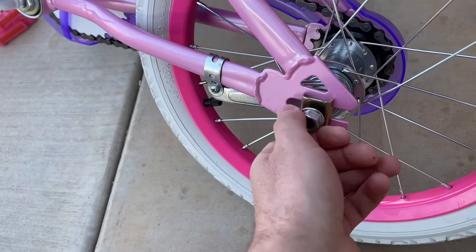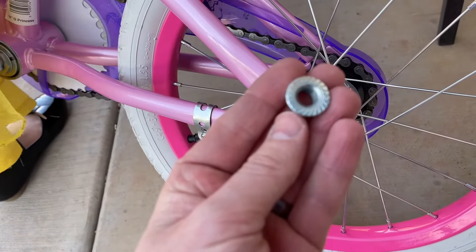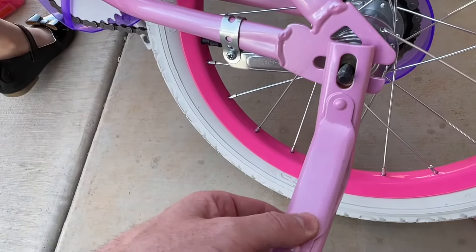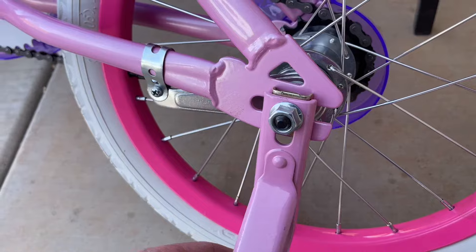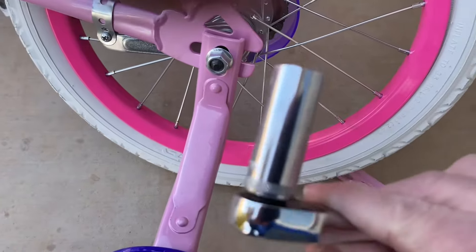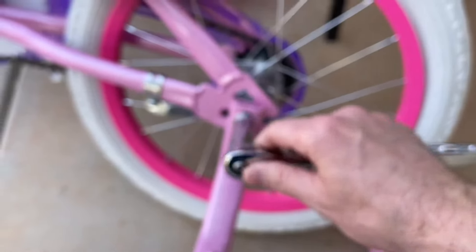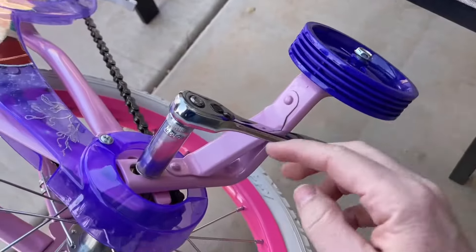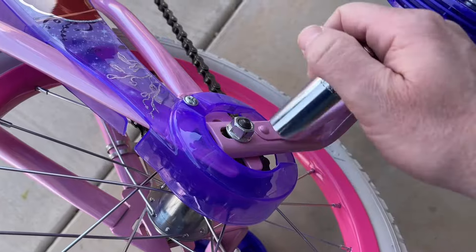As for the training wheels, this hardware was loose assuming you're going to put the training wheels on. Take the nut off and check that it has those good perforated lines to confirm it's the right hardware. The training wheel just goes right on here — put it on and tighten the nut back in. Position it so it's centered and even on both sides. Tighten down with the 15mm socket, then move to the other side and do the same thing — remove the nut, put on the training wheel, put the nut back on, center it, and tighten it down, making sure both sides are the same height.